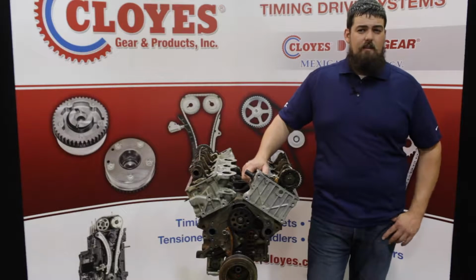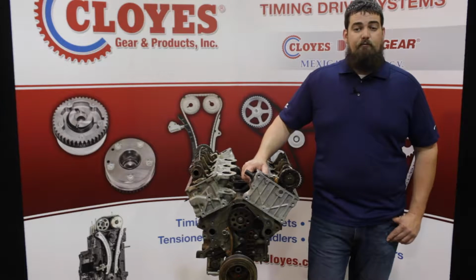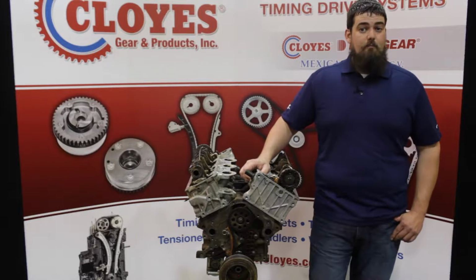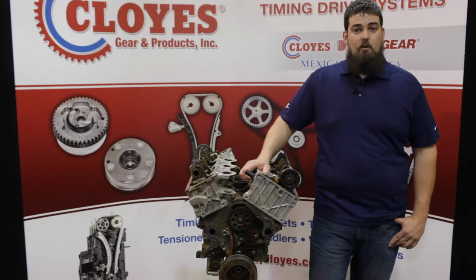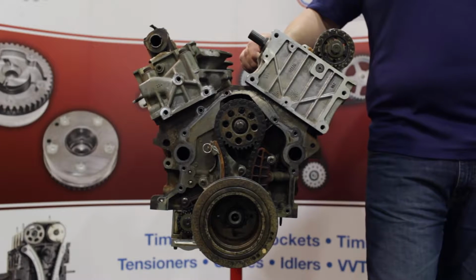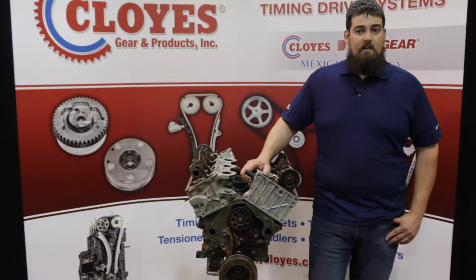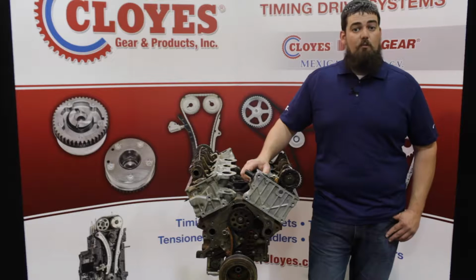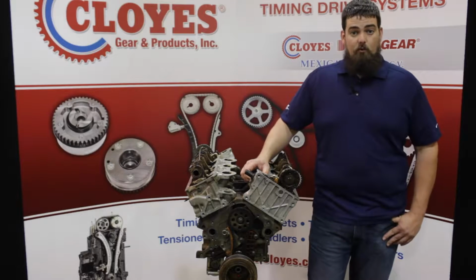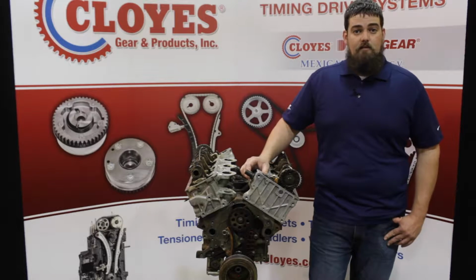In this video, I will cover the case of timing repair due to a rattle or routine maintenance, not a complete system failure. For our demonstration, we will install components of the special toolkit to preset timing before removal of the old timing components. This will locate the crankshaft at number 1 top dead center and the camshaft in their appropriate locations. If the timing system has failed, there is a separate procedure and special tool for the removal and installation of the camshaft roller followers. Roller follower removal is required if rotating individual shafts is necessary. This is an interference engine.